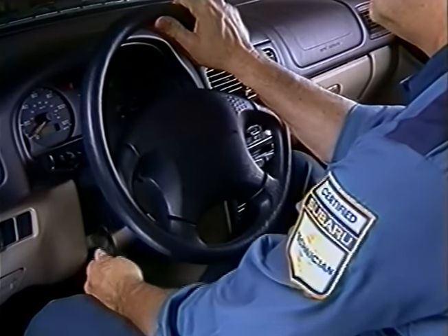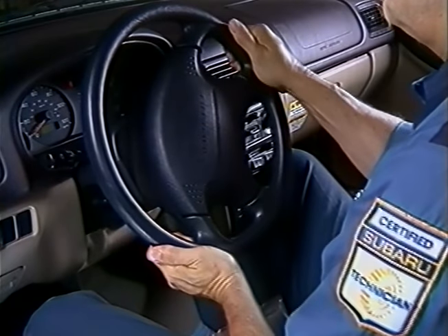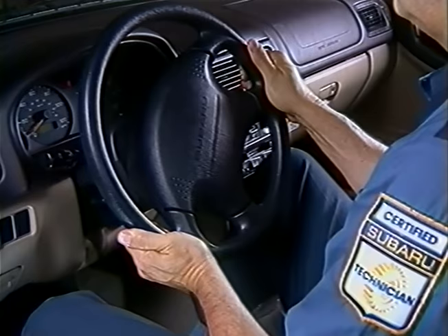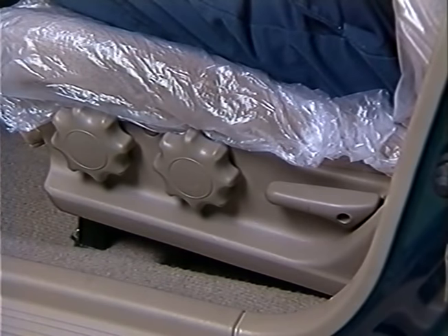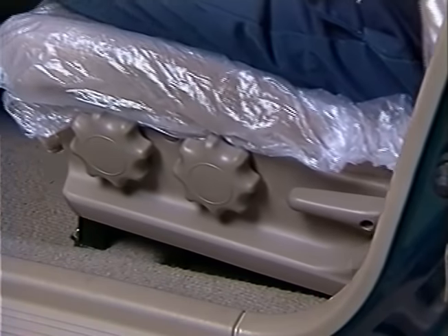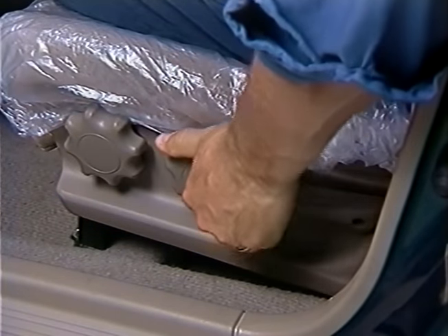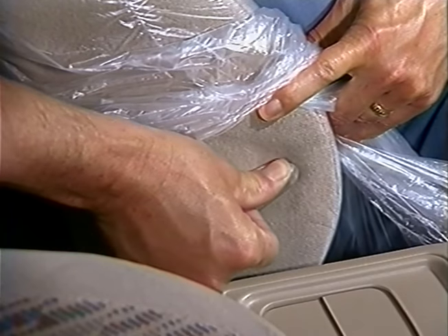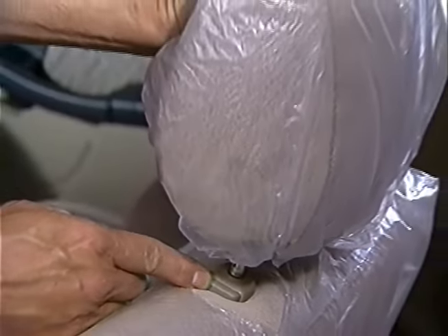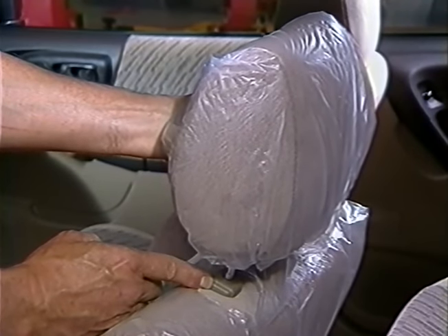Adjust the height of the steering wheel. Set the friction lock and make sure it locks the steering wheel in position. Turn the steering wheel and verify that it locks with the ignition switch off. Check all the seat adjustments. On the driver's seat, these include the front-back adjustment, the seat cushion angle and height in the front and back, the seat recliner, the lumbar support lever, and the headrest height adjustment. Next, check the passenger seat — the only adjustments on this seat are front-back and recliner.